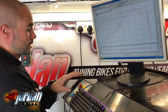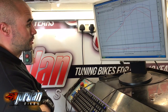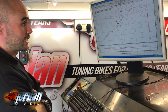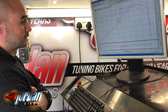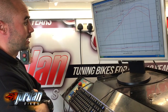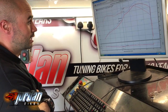That's purely down to the fueling been absolutely spot on. It was way off before, running really rich, so we've leaned that up. We've done a full ignition remap, we've tweaked the secondary throttle valve plate to make that a little bit smoother on acceleration, and turned a few unnecessary things off like lambda sensors, pair valves, and the exhaust valve.